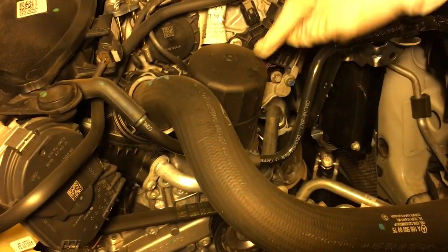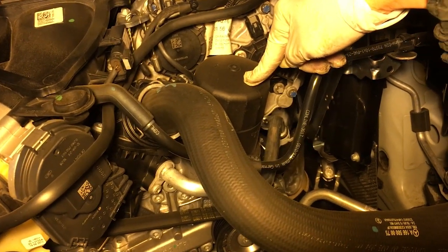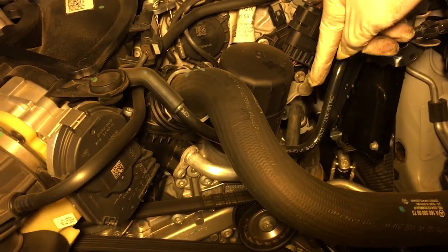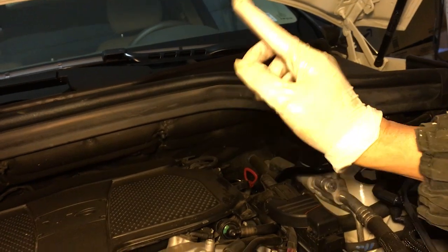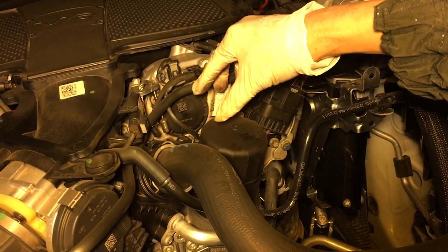So it's so easy. And the way the direction is drained downward, you will never have oil spill when you open it because it already drained down to the bottom. Some cars have it up, which has all the old oil, and that is more troublesome. So this one, I just use a filter wrench to open it.